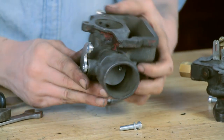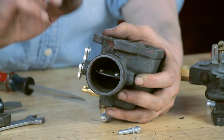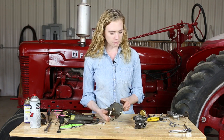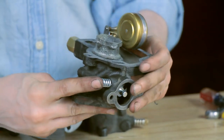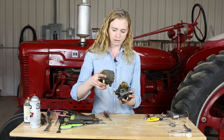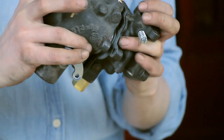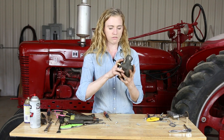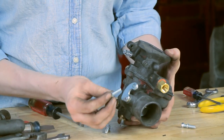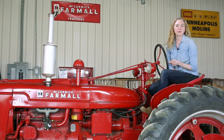My choke shaft is in. You can see that my detent ball is in place and it springs back and detents like it should — your choke shaft should work the same way. The butterfly is directional, so it only goes in one way; if you're having trouble getting it lined up, you probably have it in backwards. Here's the top — I did put my idle set screw in up here, and I have a gasket here. We're ready to drop our two halves together, being very careful of the float. I'm going to set this into place, slide it past the Venturi, and the screws come from the top down. I have new lock washers underneath all three of my screws, and I'm going to tighten these up.